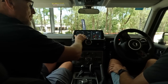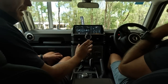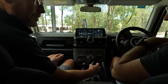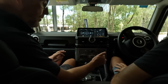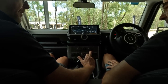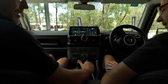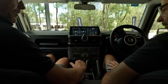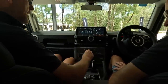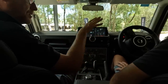You will see warning lights, there will be warning signs coming up, don't worry about it. Have you driven a BMW before? I have a BMW. So you know the controls — I won't talk you through that. The one thing I will talk you through is we will be using manual. It hasn't got sport on it, it's just manual. We will be selecting neutral, and that is for the transfer box. It's a two-speed transfer box. We have no synchros in the transfer box, so it's always done in neutral, standstill.